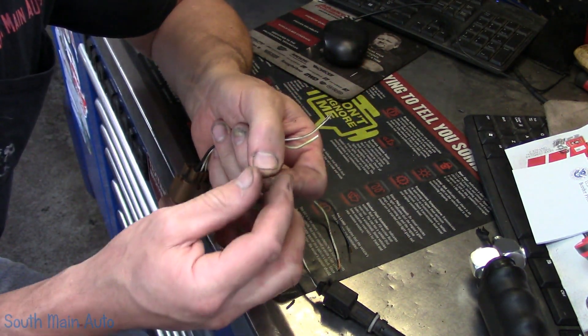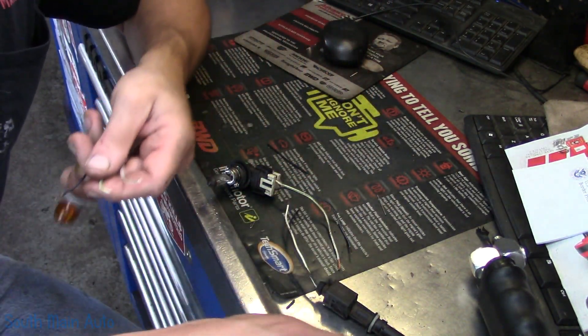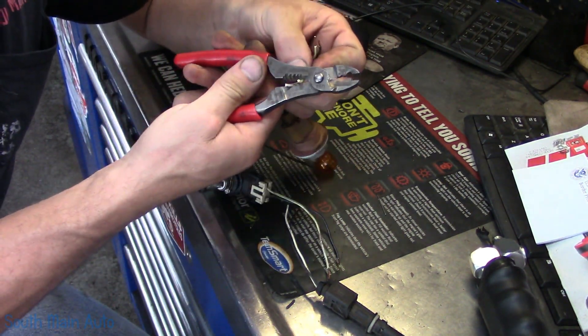When you're front probing, use your noodles so you're not going to spread the pins. I'll show you here how I do those. I've got some heat shrink tubing here we keep around the shop. I'm just chopping off a couple pieces, and then we'll do this headlight bulb here.